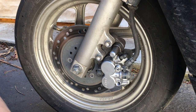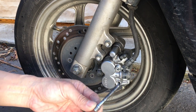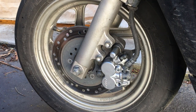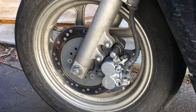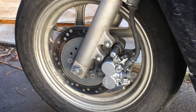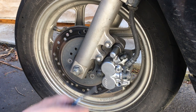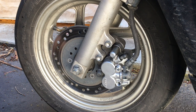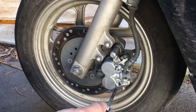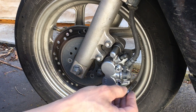I've been thinking overnight about my little pins here — how it's hard to go in and out, and potentially why my brake pads are actually wearing out faster now than they did when they were new. My original brake pads lasted something like 20,000 miles or more, and this last one lasted maybe 5,000 miles. I think part of the reason is these pins here, and I mentioned in the last video that from the corrosion they're just hard to pull in.